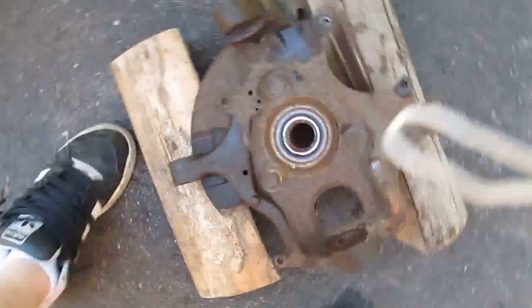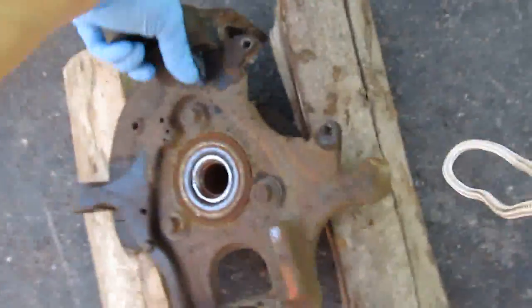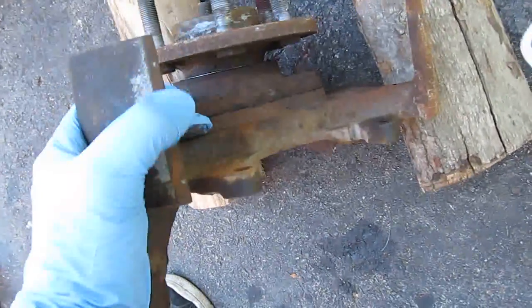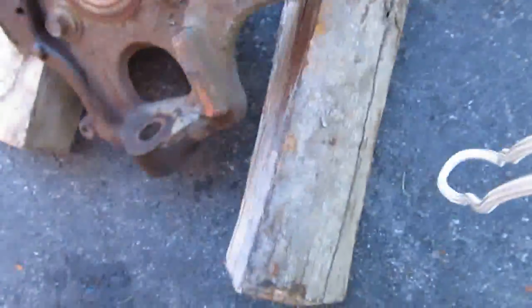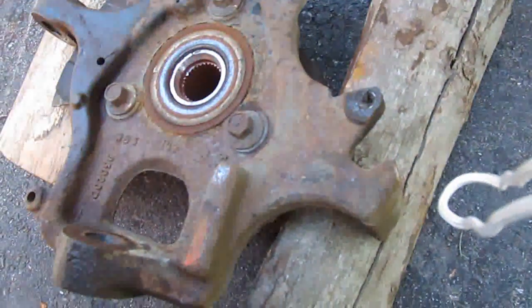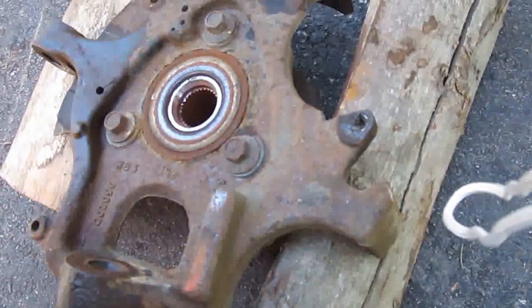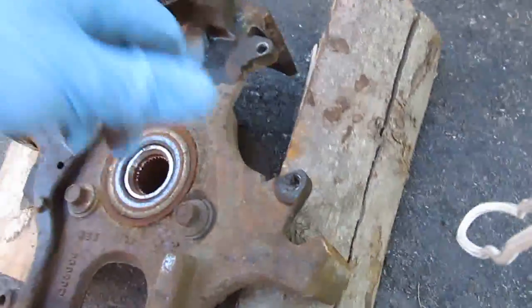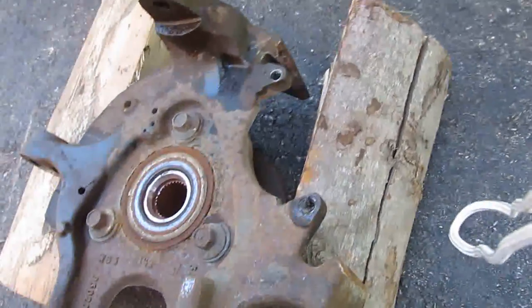So here is the old Dakota one, and this is where I seem to always have problems — right here. I didn't have this off actually that long ago, but in here the pads just catch; they just don't seem to do too well. So, we'll take this hub out and I'll show you how to do that. Basically I just loosen these off, like in my other video, and then drive them down with the air hammer.